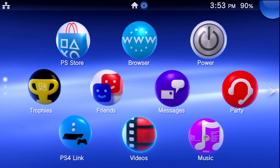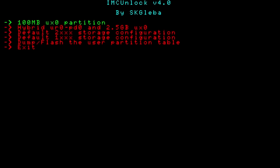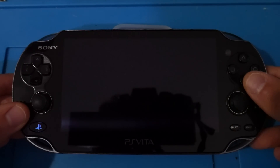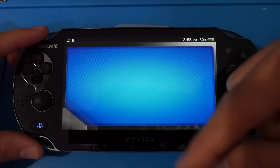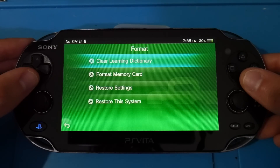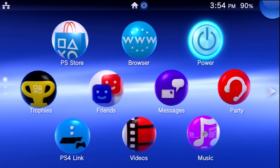Open Vita Deploy however you access it for modified or unmodified systems. Once launched, go to Miscellaneous, then 'Create an Internal Memory Card', and agree to the warning. This time, scroll down to 'Default 1000 Storage Configuration' and enable this. Let it do its thing and restart your system. Once rebooted, go back to System Settings. Go to Format, then 'Format Memory Card' — you should no longer see an option for an internal memory card format, meaning you've successfully reverted to the original stock storage state.